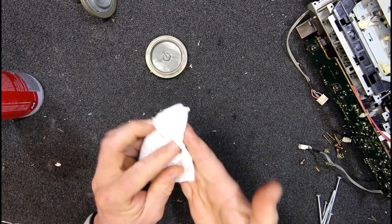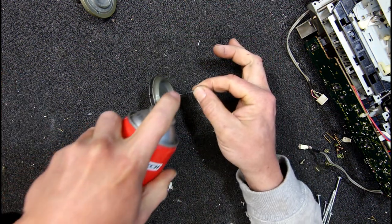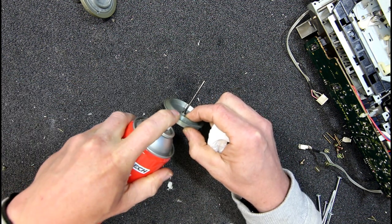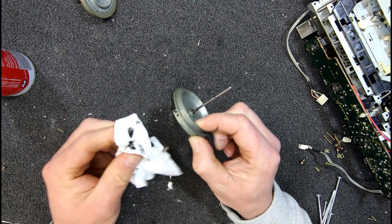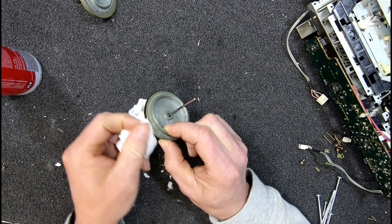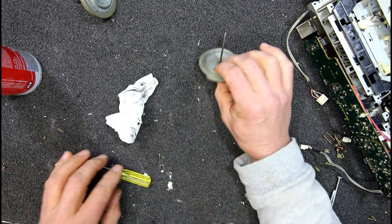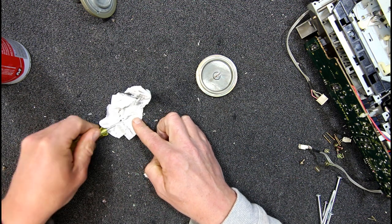Carburetor cleaner stuff does seem to dissolve it even off skin at times. Now I'm wiping it on the shaft — look at that, it just blows it away. I'm not sure if that's proper rubber residue or not, but it just dissolves it. Let's try it on a bit of the genuine stuff — yeah, that seems to be working. That's a damn sight better than anything I've tried before. Look at that, it's being taken right off. This throttle body cleaner is made for getting rid of exactly this sort of horrible residue. There's a bit on my screwdriver — yeah, that's just dripping off pretty much.